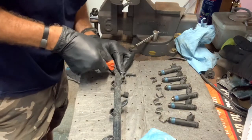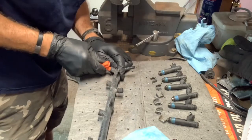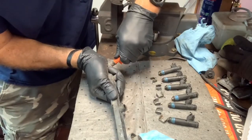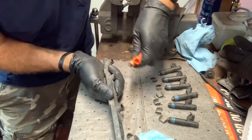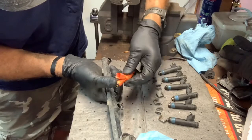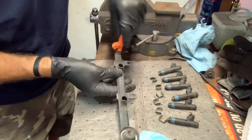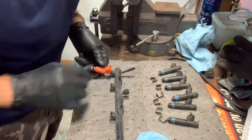We'll just install it. You'll want to do an O-ring count to make sure you have all the old O-rings out — I've already done that. This kind of pushes in. There we go — slid right in, no problems at all. Five to go.